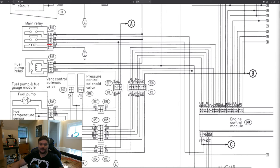If we follow this side of the coil, you can see that it goes right to the ECU — not the key. How can the ECU turn that relay on if that relay powers the ECU? That's a chicken-before-egg situation — the ECU can't turn itself on if it doesn't have any power. This is where we've got to get creative. Sure, the ECU gets its main power through the main relay, but it also has a separate always-on power wire that isn't switched by the key. It always has 12 volts, so in reality your ECU is always on, but just in a deep sleep power-saving mode. When you turn the key on, it wakes up from that deep sleep and turns on the main relay. Why is it like this? No clue — that's just how the factory system works.